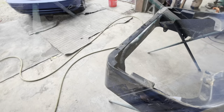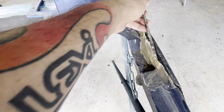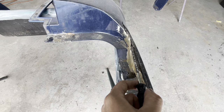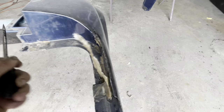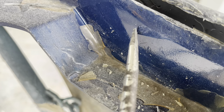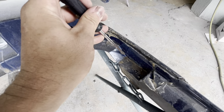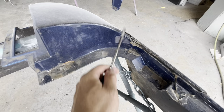Let's pop some of this off with a screwdriver. See — that's not adhered at all. There's no strength to this repair. Number one, it's the wrong product. You should be using a plastic repair, as we've gone over many times on this channel. And you've got to prep it. I'm curious if whoever did this even prepped it. None of this is even sanded — you can see the reflection. Paint products don't adhere to glossy surfaces. It doesn't matter what product you're using in the paint or body work industry — it has to be prepped out.